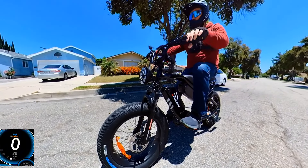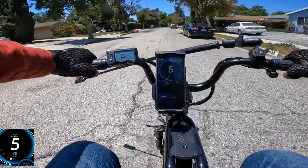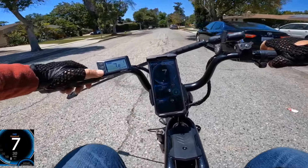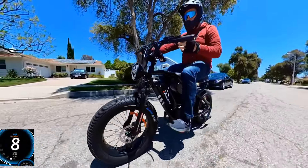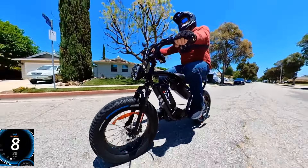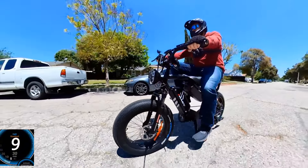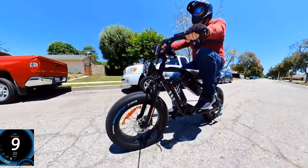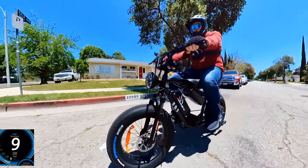The top peak power was over 1700 watts. With the bike turned off on zero power, you can still pedal on flat surface — not much resistance. You can pedal easily at around 9 mph with no power assist.